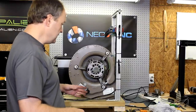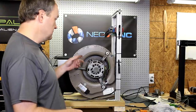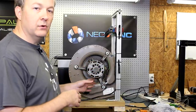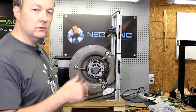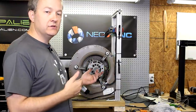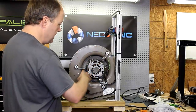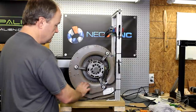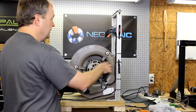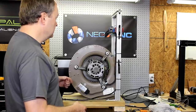She spins quite freely now, which she was definitely not doing before. I think what had happened was it just ran dry, got hot, and the bushings wore. After reorienting everything, I had to move the capacitor — it was right here, moved it down. Ground wires are over here tied together. Didn't have to do anything with the wiring except unplug it and plug it back in. So that worked out.